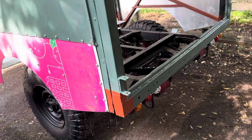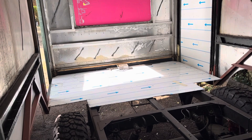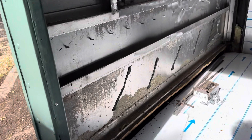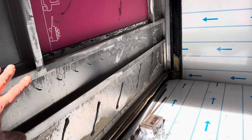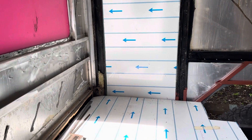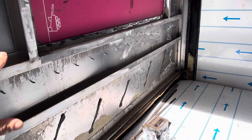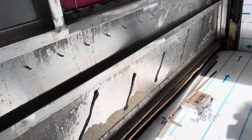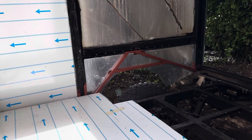We need some form of 12-volt power in here to charge phones and run computers, so we've gone all 12 volt — no 240, no hook-up voltage. After the electrics are done, the next job is insulation. The 25mm insulation has already arrived and will go in all the crevices to make it solid. We also need soundproofing — actually anti-vibration dampening — on each panel. That's the original anti-vibration material on the trailer, and it'll give a nice dull thud when we're done.